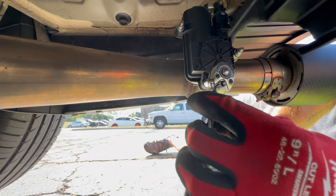Alright guys, this is the comparison of the stock OEM spring to the Torkan spring. The OEM one has fewer coils but it feels more squishy — over time it's definitely gonna get worn out from all the heat cycles. The Torkan is definitely harder material — I can squeeze it but it takes way more strength. Let's put this one in and see how it performs.